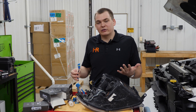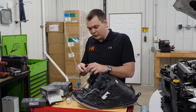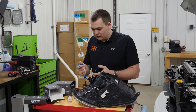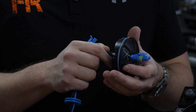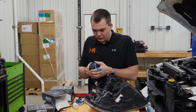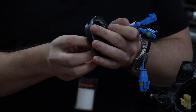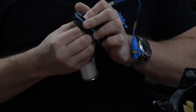In the past with older HID videos, we used to have to take a pick tool, go deep in the connectors, remove the little locking tabs, take it all apart, pass it through and then reassemble it on the other side — it was kind of annoying. With these new GTR Lighting bulbs and harnesses, it's not the case anymore. If you drill this out to between 7/8 and 1 inch — 7/8 is a tighter fit for the grommet so I prefer to stay close to 7/8, but going up to 1 inch makes it a little easier. Pass your wiring through, no need to dig in anymore. As a former full-time installer I absolutely love that, and for the guy at home doing DIY work, this saves you a lot of effort.